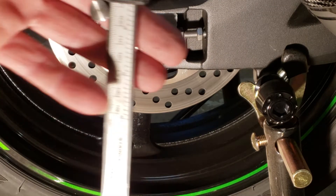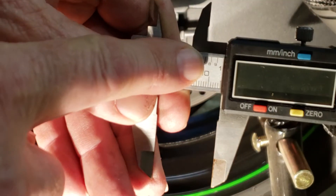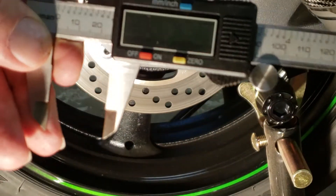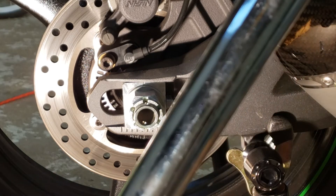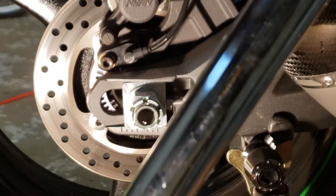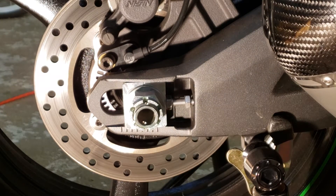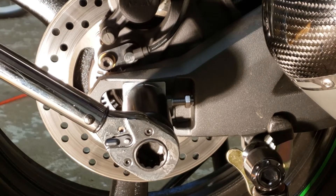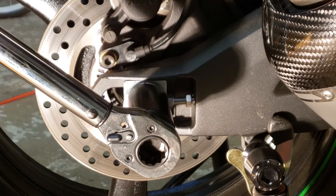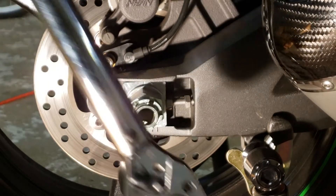The battery is dead but you can still read the measurements right here, so I'm going to check the other side. Okay, I've got the torque wrench set for 95.9 foot-pounds. I've already snugged it up — let's torque it. Alright.